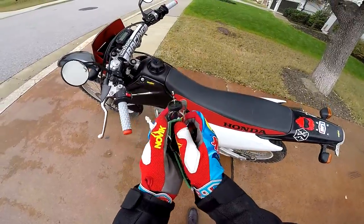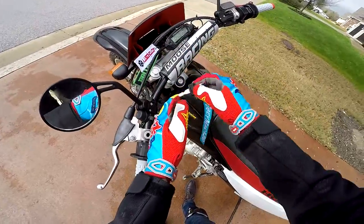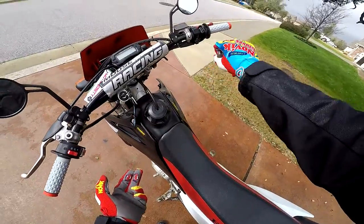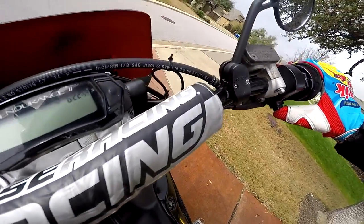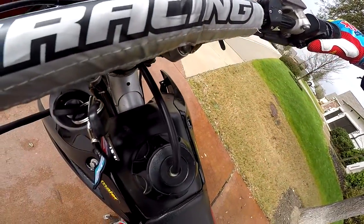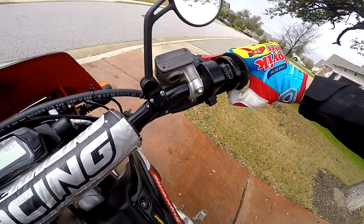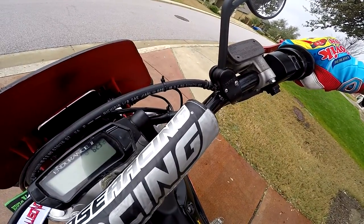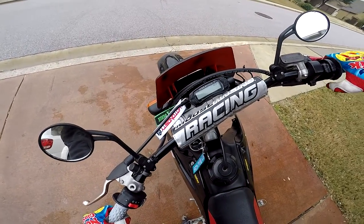Let's see if the bike will start up first try. This bike has a problem of not starting — it'll start, it just won't stay at idle, so you gotta keep revving it. When you put the choke on high you just gotta keep revving it. Let's turn the gas on. Let's try it with no choke first — I started it up earlier. Put the choke on high. Medium. Low. There we go — it dies again.